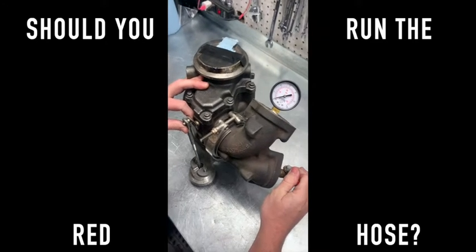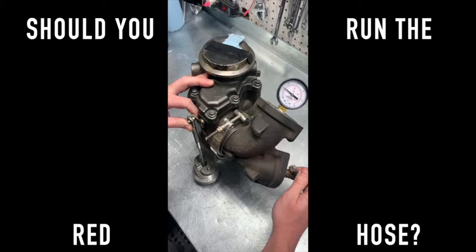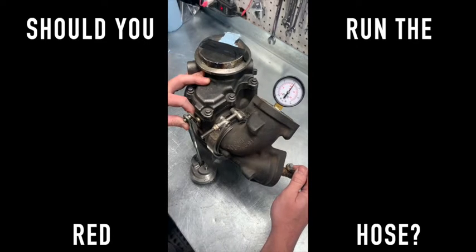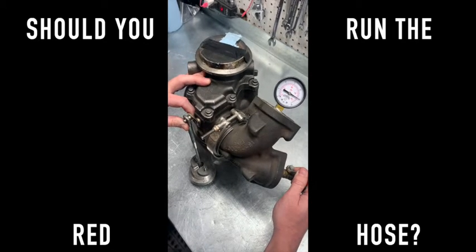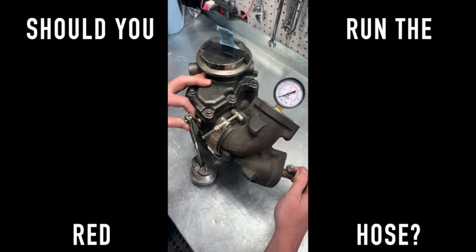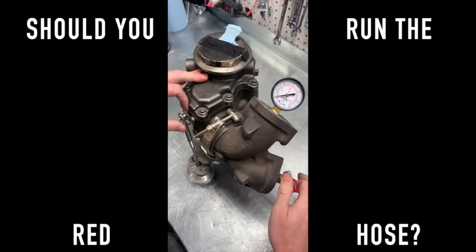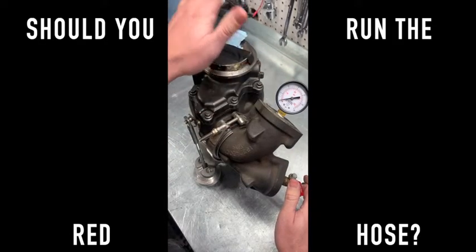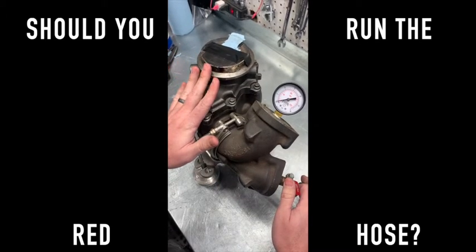Let's tighten it again. Now you can see as you tighten the turnbuckle, it's just going to delay at what PSI the wastegate starts to open. It'll still open even with the red hose unhooked - it still works perfectly fine without the red hose hooked in.